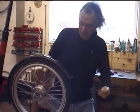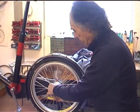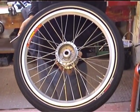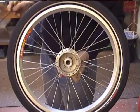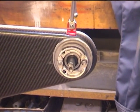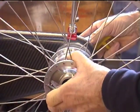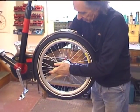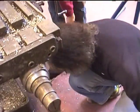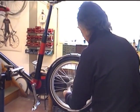Back wheel — comes off the same, it's the same hub but it doesn't have bearings in it. The bearings are in the bike, so we remove the bearings and bond in the lug. That has an aluminium piece that I machine up, inserted in, which has got a hexagon hole that I broach, and they've got the hexagon drive on the end there. With any luck it'll slide on in any one position — some get a bit of tolerance and there's a best position, but this one tends to go on in any direction. You then hold the cranks and rotate it back to find the position. These are things there's no reason to do normally other than maybe transport.